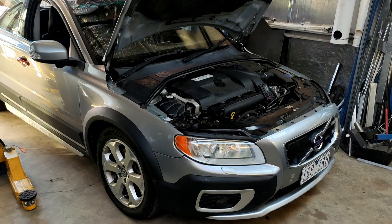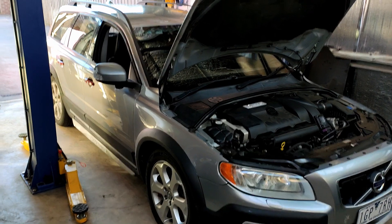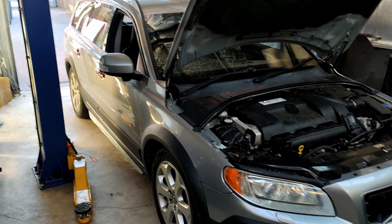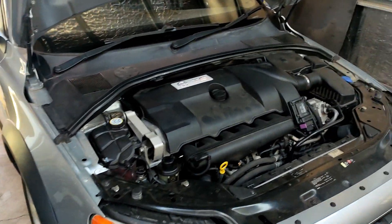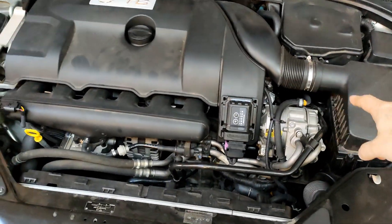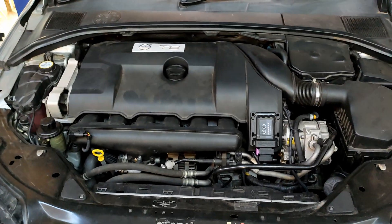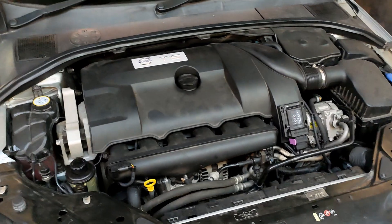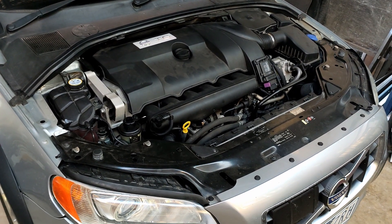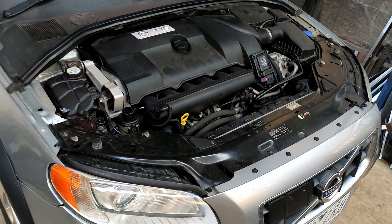Things that I still need to do: the car is 95% finished — I've probably done 2,500Ks on it since the engine conversion, still polishing the edges. Obviously I still need to paint the handles. The power steering is one thing — it sits underneath the battery over here, and you can see this pipe here runs all the way across to the reservoir, with a cooler running in here. The short of it is it's a bitch to bleed. I'm really struggling to get the air out of the system, so the power steering is quite noisy. I have used the recommended fluid in there, but I just can't seem to get the noise out of it. I may have damaged the pump running it with air in it for so long. So I'm going to need to attempt another full bleed of that system.